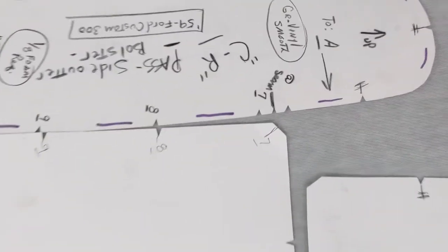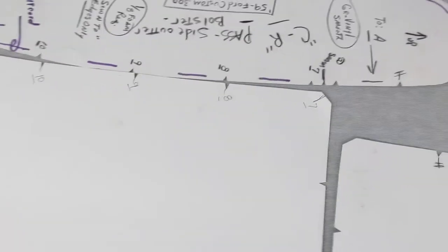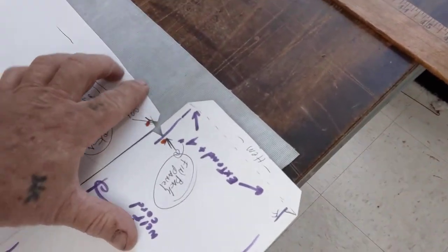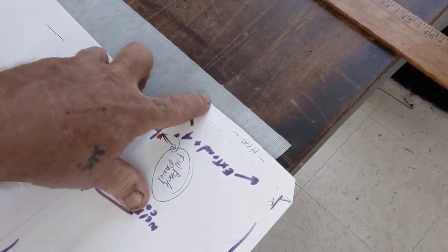You can see all the little red dots over there — they catch my eye. I know that this piece here will end up at the top, and then this one will end up going down the back. And then this — this is orange, excuse me, not red — orange, that just catches your eye. That's where this has got to finish. Then you have the hog ring that goes on here, but this tail actually goes down below with a hem in it, and that makes off for where it's pulled over the side of the seat where the hinge is at.